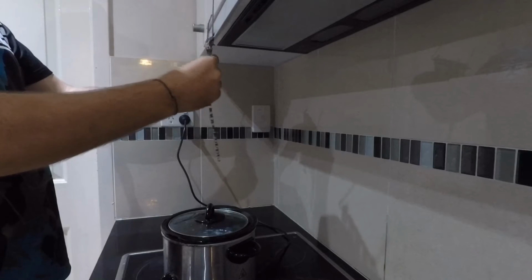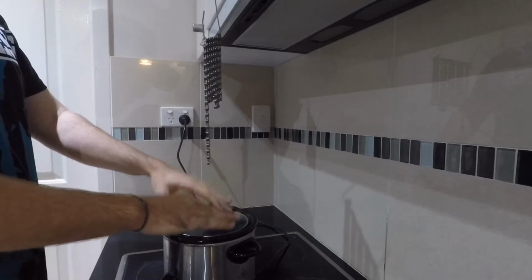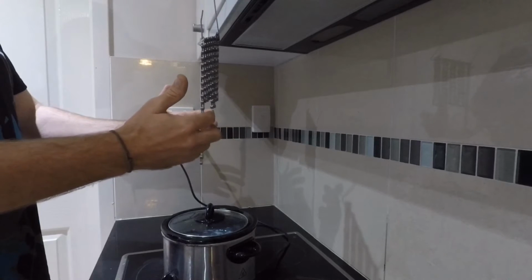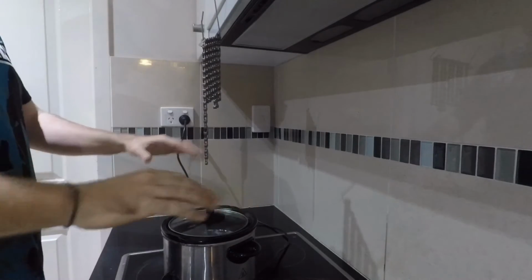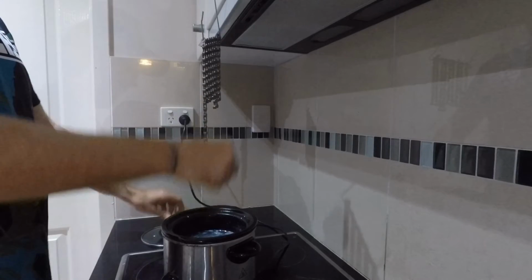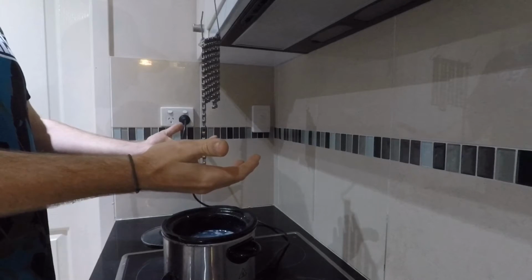So my chain is all dry, it's completely bare metal. Now the little setup that I've got: my little 1.5 litre crock pot with the PTFE powder and paraffin wax mix in it. The way that I've got it set up is I actually dangle the chain straight off the top of a handle, like this is my stovetop. What that does is when I take it out, I can hang it back up on this chain and any residual drips just go straight back into the pot, so I'm not having any wastage.